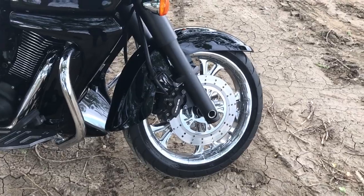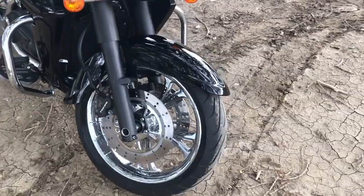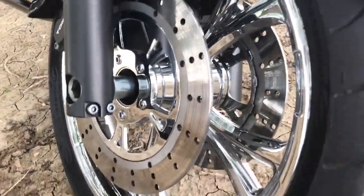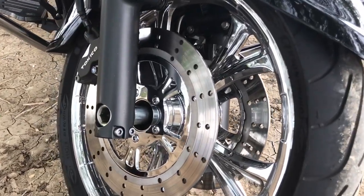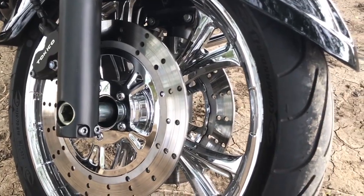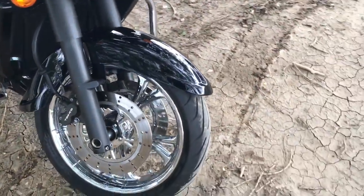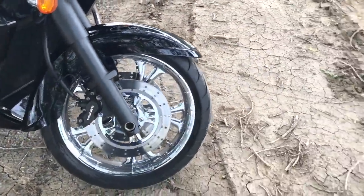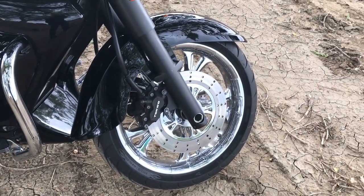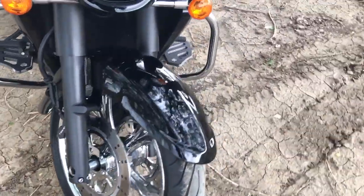There are several companies that make these wheels for us. I don't have ABS — ABS came along a few years later in the Vaquero. What you see here is a Harley-Davidson style hub with Harley-Davidson rotors, matching rotors to the wheel, using your stock calipers in the stock position, so it's very easy to swap over. The downside is this wheel can't be sold to anybody that has ABS, because you need the ABS ring on the left-hand side of the hub and the stock rotors.